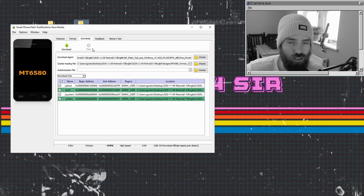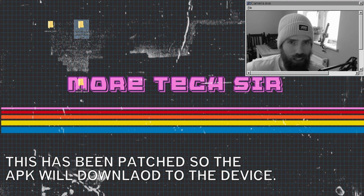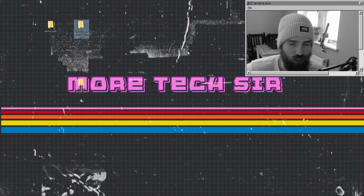Now there's another way to do it, and that is through the OTA upgrade. Now there is a bit of a problem at the minute because the servers are down, because everyone seems to be piling into it, but I will leave a link below as well for the OTA upgrade APK. All you need to do on that is drag and drop it in. You will install it. You'll just follow the instructions, press open and install. And once you've done that, let it install, and then it'll say it's complete. And then once that's it, you can give it a reboot if you want. You don't have to, and then you will get an upgrade.